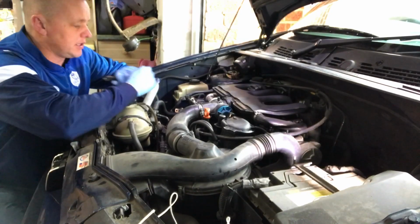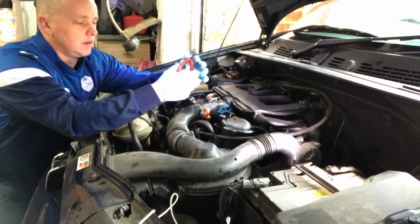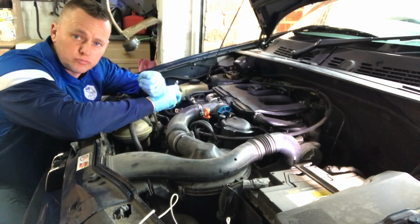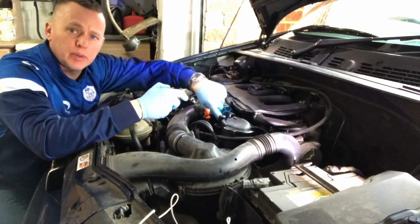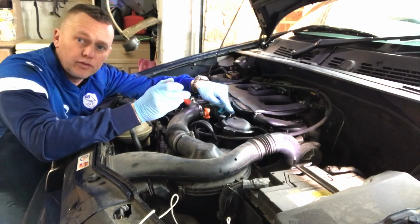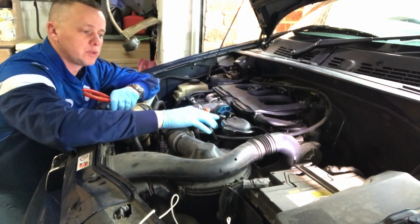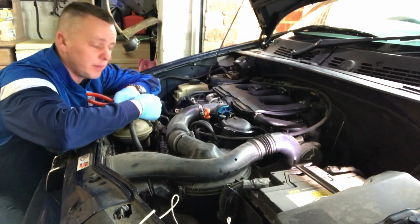So today we've got an issue with the Peugeot Partner. Wouldn't start, so when you leave it overnight, you crank it over in the morning, won't fire up. I had a look and found there to be air ingress in the main fuel feed pipe into the pump. Got a big air bubble in there, so when I pump up the filter primer, you can see the air bubble tracking back down the pipe.